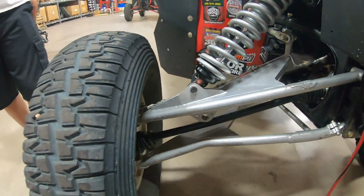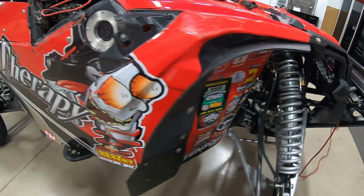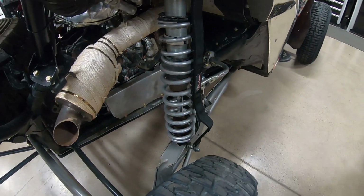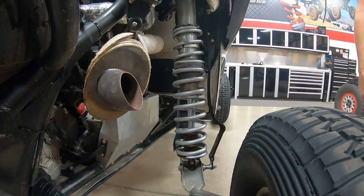We've got, I would say, 1,000 limit strap kits out on the market. We have no bent bolts. We don't have any failures in upper clamps or clevises. The only thing we've ever seen is basically tearing of the strap when the lower clevis, when the lower tab is not tightened perfectly straight. It's tight and crooked and it'll tear the strap.